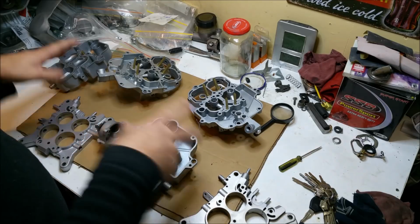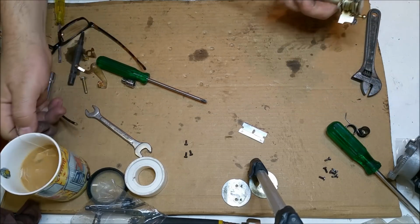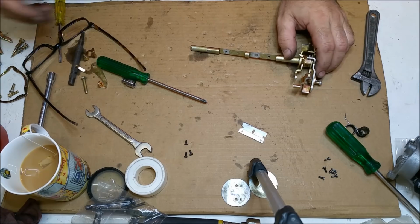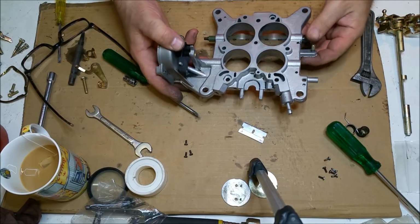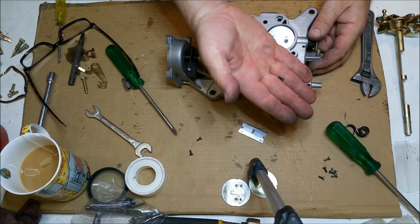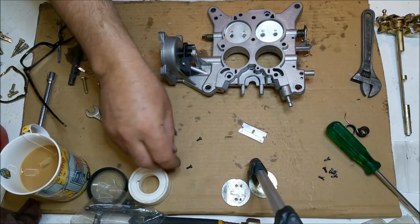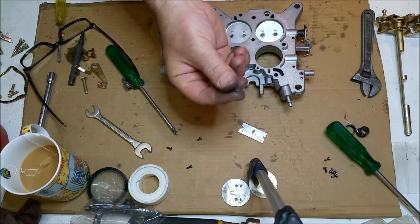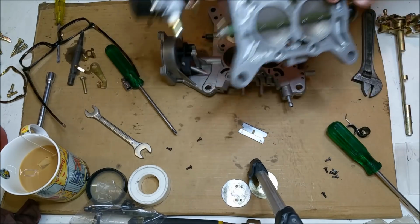So basically I'm just going to clean up this area, and I'll start putting it back together. I've got the throttle shaft here. I've riveted those two. They're stainless rivets, they were hellish. The throttle body, I've put in the secondaries. There's a bit of thread protruding through. None of these bolts were peened over. They're those little fasteners. Some of them were bent, some of them looked awful, and I wasn't going to put them back in. The heads were knackered on them, like this one, and sometimes the threads looked a bit damaged as well.